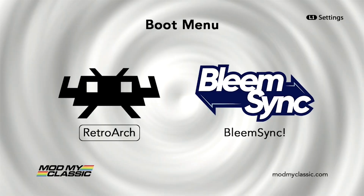Alright guys, so here we are on our PlayStation Classic BleemSync boot menu, and as you can see, our OTG USB adapter is working perfectly fine, everything's good. The really nice thing about OTG support is that it's now 100% going to eliminate any power issues with USB drives. A lot of you were reaching out saying, hey, my USB drive isn't working, or it loads and then halfway through a game it crashes and I have to restart. That's because the USB ports on the front of the PlayStation Classic weren't able to supply enough power for the USB drive. That's no longer going to be the case.